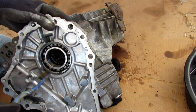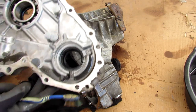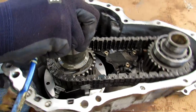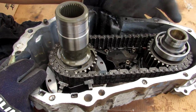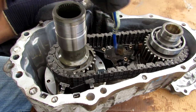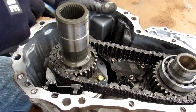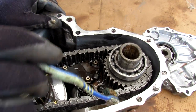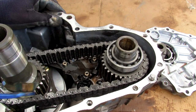There's the cover removed. Inside the cover we have a set of bearings, which is the front main bearing of the input shaft — it just rolls around like that. On the other side there's just an oil seal. Looking inside, as I rotate the input shaft you can see how the front prop shaft output rotates. We've got the main bearing for the front prop shaft as well. Inside there's an electrical connection that goes to the clutch controlling this AWD system, and a bunch of oil baffles. The fill port is here, which means everything from that level downward is covered in oil — and that chain helps slosh things around and cool things down.